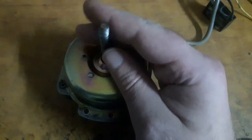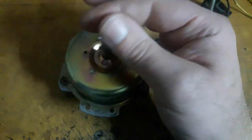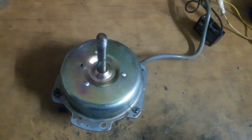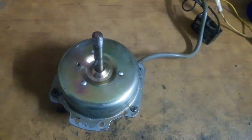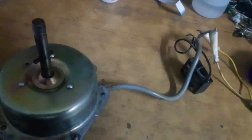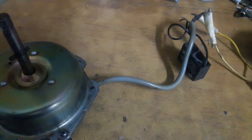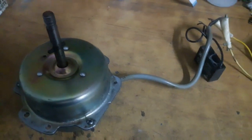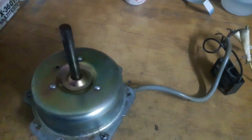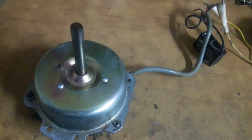Now when I reassembled the fan, the motor did not spin at the right speed either. So I oiled the bearing, and as we can see there's no effort — it spins — however it's still not functioning with the same momentum it should. A single-phase motor always uses a capacitor as a starter, so I'm suspecting either the motor is bad or the capacitor is bad.